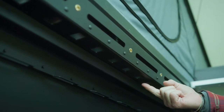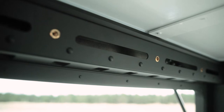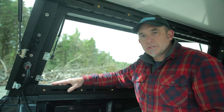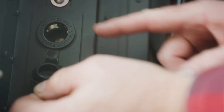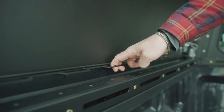The other cool thing about box beams is that it allows us to have a raceway for you to run your electrical, you can run water lines, you can run anything throughout the entire framework of the canopy. It allows for a lot more customization and cleaner design. In addition to the electrical chase ways that you get with the hollow beams, the X1 comes with a 12 volt port and a dual USB charging station and you can access all that from behind these removable panels. We tried to add utility to every design decision that we made.